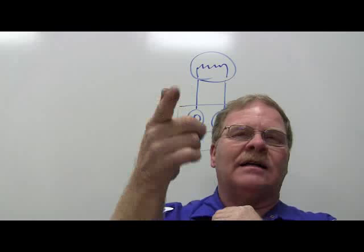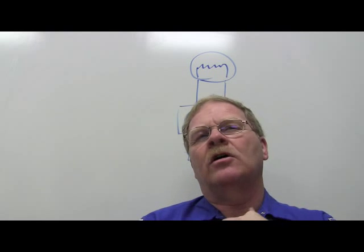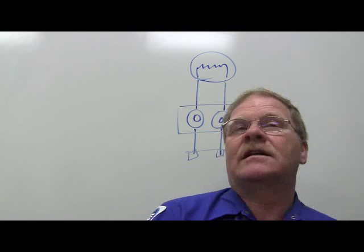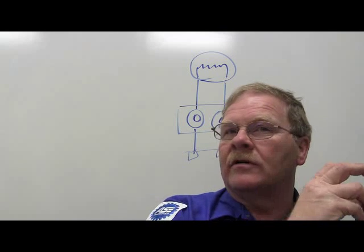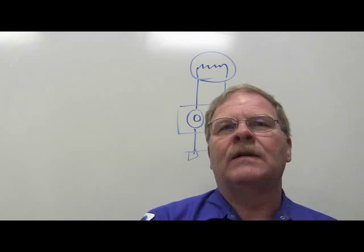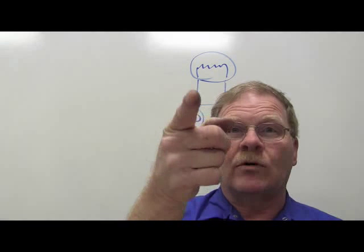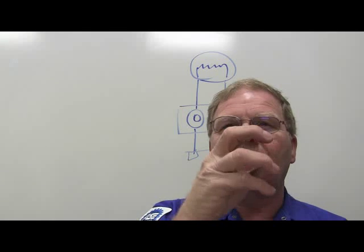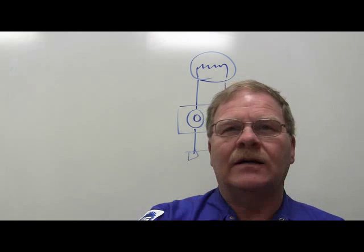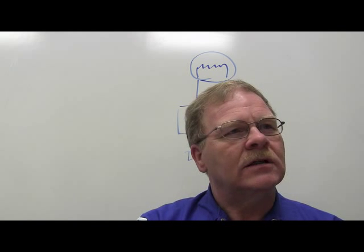That has actually got, is that a 6 liter? Yeah, that 6 liter, you've got an actual horizontal fuel conditioning module on the inside of the frame down there, and it's got a water and fuel sensor on it. There's a fuel pump in that thing, there's a filter in that thing, and there's a water and fuel sensor in that thing. And yours is saying water and fuel now? Mm-hmm. Well, a lot of times that silly little thing, we ought to have a look at that for him, because it ain't that complicated. You know what I'm saying?